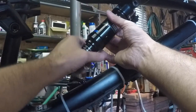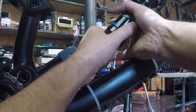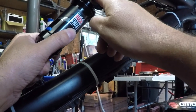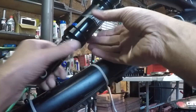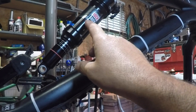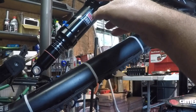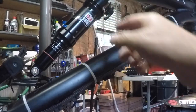I think that's all the way — give it a little tug — and our volume reducers are actually right up underneath this seal. Now, if you pull the can all the way off you're going to have to refill it with oil, so by just sliding it down and sliding that seal down a little bit, we can get at the volume reducer.